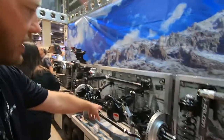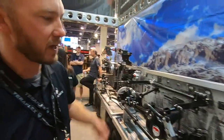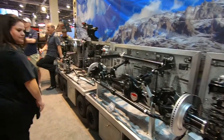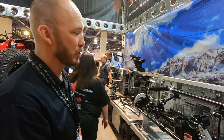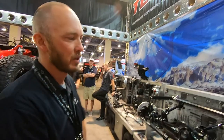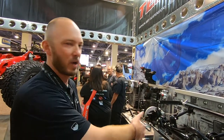And what is this over here? This is one of our Terra 60 front axles. On one side, we've upgraded it to the eight-lug lockout hub version. On the other side, it's the five-on-five factory bolt pattern — so it just depends on how mild or wild you want to go. When would you recommend someone go with a big 60 axle like this? I had this kind of axle on my JK because I was running 39-inch tires and I like to do a lot of really hardcore off-roading, and I drive a lot, so I wanted my vehicle to be really heavy duty to go out on the trails without breaking anything.